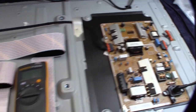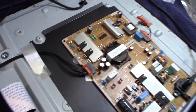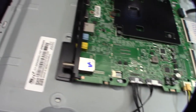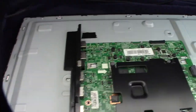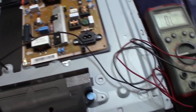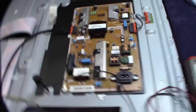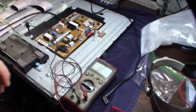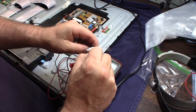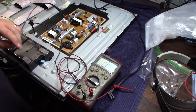Since I know the backlight is good, I don't have to completely tear this thing apart to replace an LED strip. I'll go back and check the voltages now. The PCB gives me a graph of what to check, which is really convenient. I've got my multimeter connected with some clips. Pins 10 and 12 should be ground — I can hear the multimeter confirming those are ground. Looking good so far.